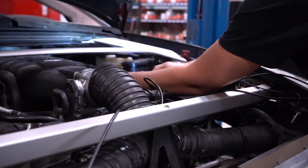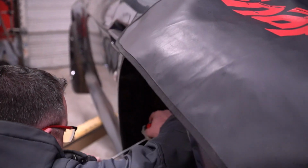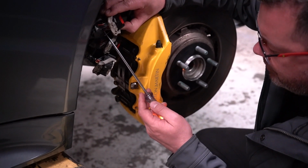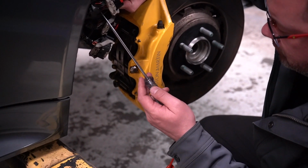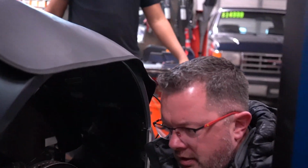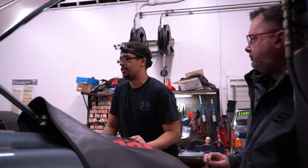No light. Oh, now. Yep. Alrighty. Go ahead and take it off. Okay. Yep. Okay, so your injection harness is good. What does that tell you you need to check next? Powers and grounds for the ECU.